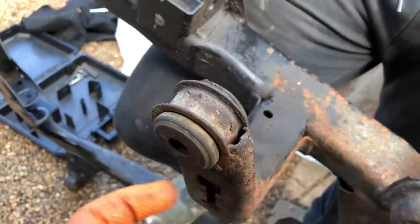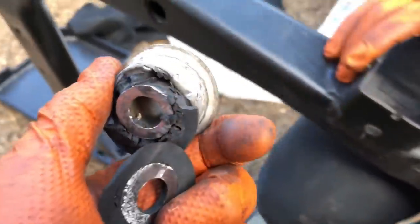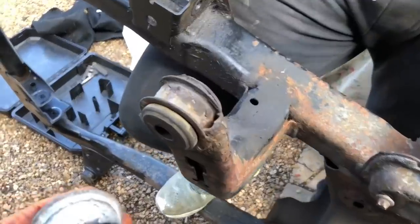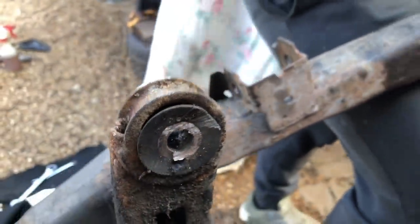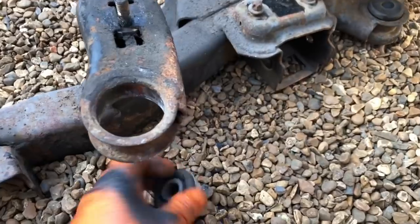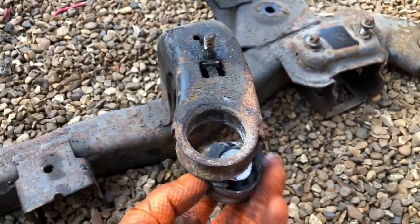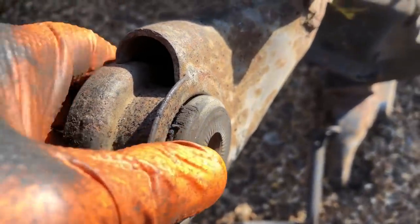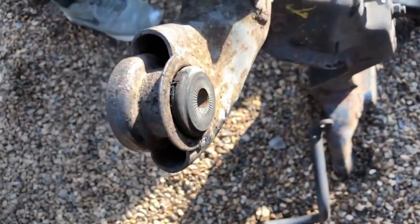Removing these subframe bushes now. I took out a couple already — the way I'm doing it isn't the best way or the only way, but it's the quickest. Just cutting off the heads — there's a metal sleeve around here. Cut off the heads and then you can just tap the aluminium sleeve, knocks the bush straight out. The solid subframe bushes have no plate, so you can get in with a small chisel and chisel out the aluminium casing — it just pops the whole sleeve out. Once you cut the top off you can get in there, give it a couple of taps and it just pops out. There's loads of ways — pressing them out, burning them out — but that's the easiest. There's so much play in these bushes, you can see movement even with a finger. You can't really tell from underneath until you get the subframe off, but the amount of launching at Santa Pod has given these bushes an absolute beating.